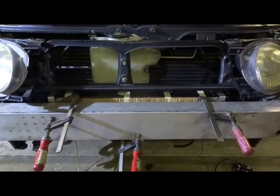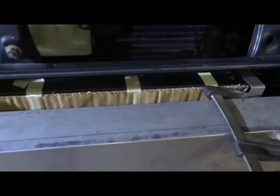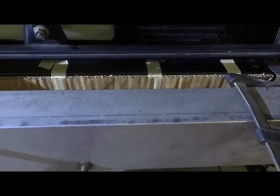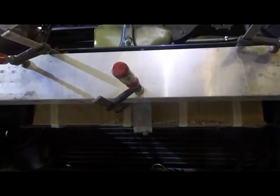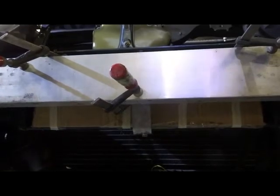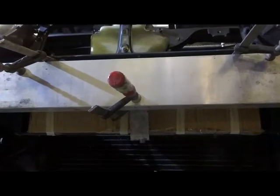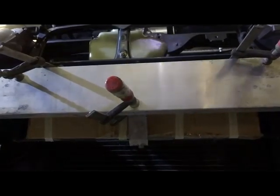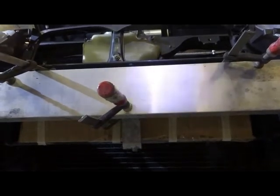Okay, I've got the intercooler radiator mounted. It's about 30mm in behind there. Can't go any lower because then they'll get no air getting into the radiator setup. So that's in the first half of the scoop. It's going to be sitting into the bottom of the first half of the scoop, and the second half of the scoop is going to go into the radiator and all the other radiator setup inside there for the air conditioning and all that sort of stuff.